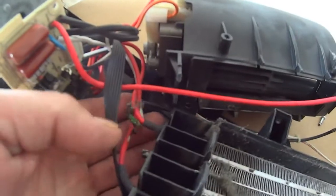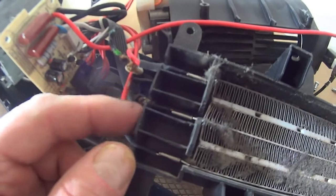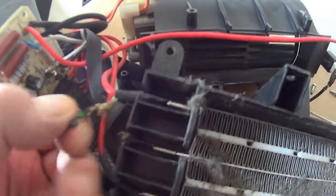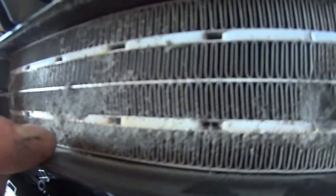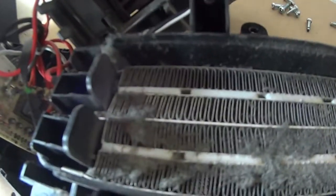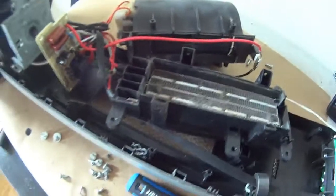So I've taken it apart. Somehow moisture got in here — this is super corroded. It got so hot that it just broke off — arcing and what not. So I'll just take off this clip, crimp on another one, and I'll have to replace the wire. Hopefully this works. Needs a little bit of a cleaning, it's all dirty in here — you can see all this dust. That's the problem here, this would be the reason why it's not heating up. If that's it I'll fix it — we'll try it out after.